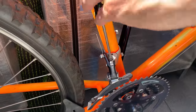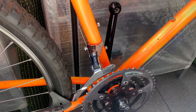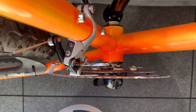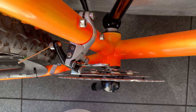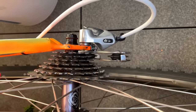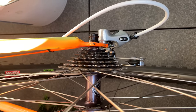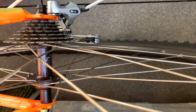And then here just saying the limit screws. Basically, these screws limit how far your derailleur goes on the inside and the outside. I might do a full tutorial on this later, but this is just a brief explanation. Basically you just want your chain to be able to access your higher and lower cogs without it popping off. And it's the same thing for the rear. Pretty straightforward concept. If you want a tutorial, just leave a comment or something.